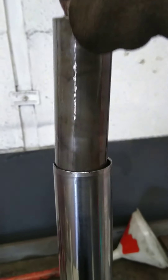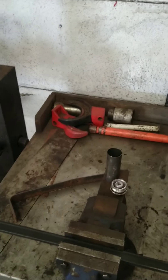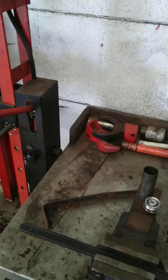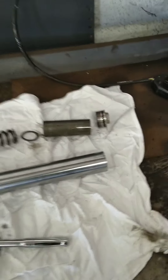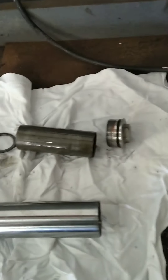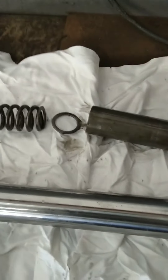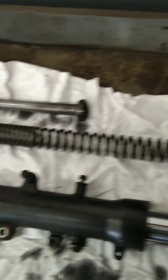So you've got the top bolt out. You can see I'm trying to get out the spacer — not a spacer, it's like a tube. The spacer is like a washer that goes underneath that. Then tip the oil out and just pump it a few times. That's where the spring removes from. You can see the metal O-ring spacer there — that sits on top. It's all laid out in order so you can see the order it came out in.